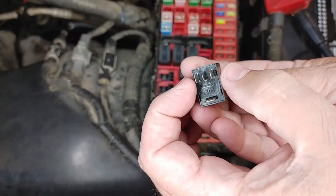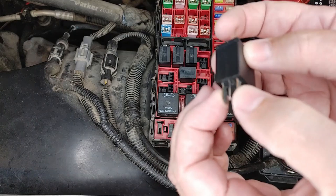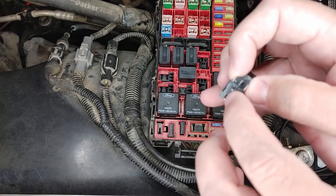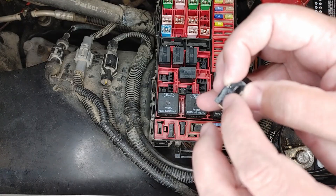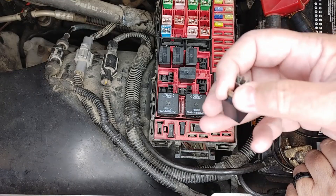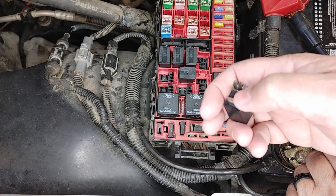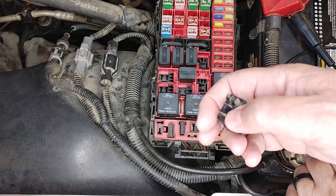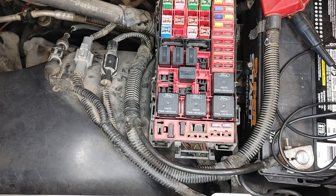But if you go from here to here with a 9-volt battery, the relay will click. But then you've got to check continuity from here to here to see if it's actually working or not, because it could click and not actually work. So keep in mind, a relay can click but the contacts can be bad — if you have too much resistance, that's why we check continuity there. Or you could do a voltage drop across that too, to where you're applying voltage as you're applying voltage here, and we could take pins and do that.